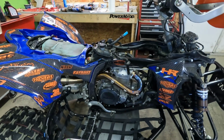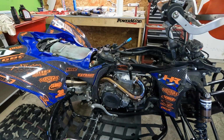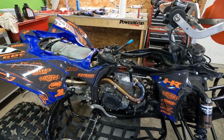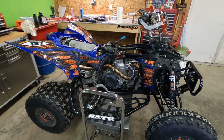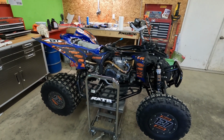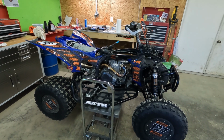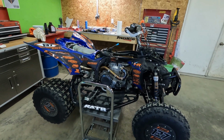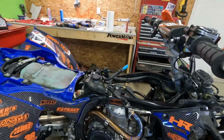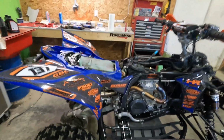Okay guys, well, I'm interrupting the outro of this video, because some new stuff has come to light. I was talking about this thing possibly being lean, and just for my own peace of mind, I decided to run out and do a plug chop real quick out on the road. So I let it warm up, went out. I think I was in 4th gear. I ran wide open throttle, shut the key off, and came in and did a plug chop.